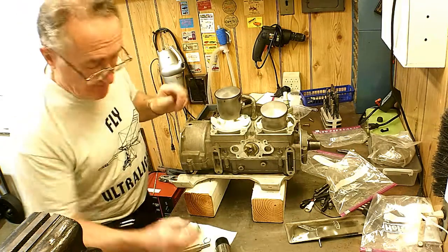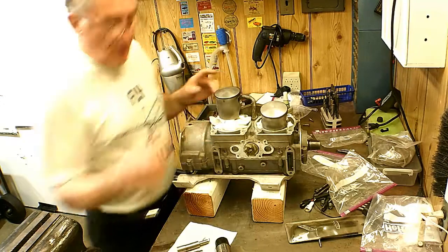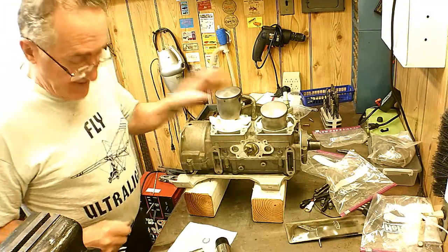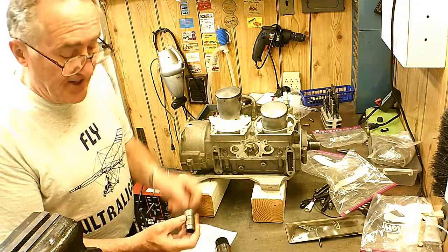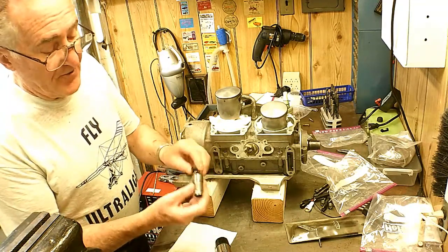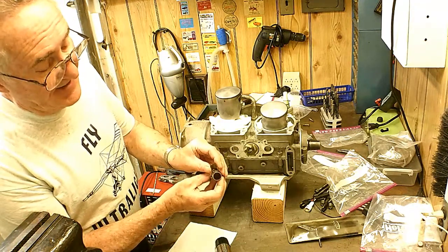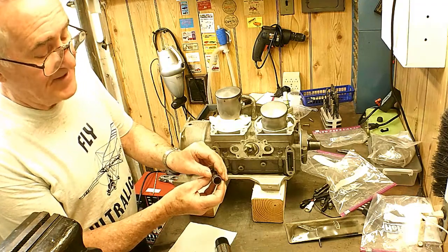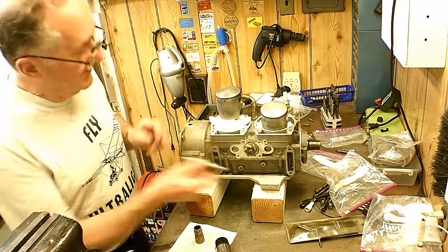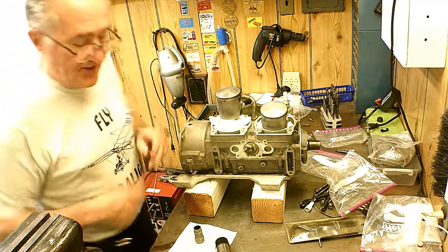That's it — now it's locked on there, piston can't come off. All I got to do is the same for the other one. I put the thing in from this end because it's got a little taper and it kind of helps me get it started, then I drive it down right up to the edge of that. It's still compressed in there but it's right at the edge. Then I use this little locating pin to go inside the wrist pin and smack it with a hammer, and that thing will pop right inside.